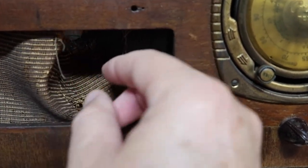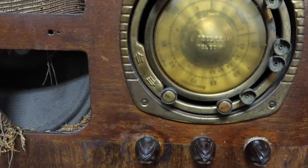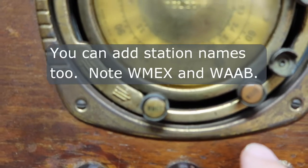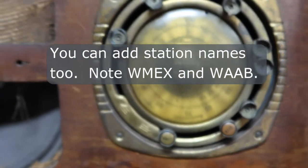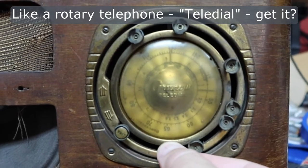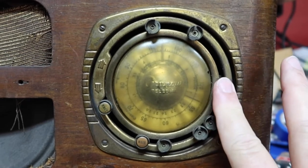It looks like it's original for sure. I can see the speaker a little bit inside — I haven't had it out of the cabinet yet and it looks okay so far. What's really interesting is it's got a different kind of dial system. See how it turns as you tune it — the whole dial turns. It's got some interesting items: these points here are like a primitive type of automatic tuning. You can program a station where you want around the dial, push it in and turn the whole dial, and here it hits the stop.